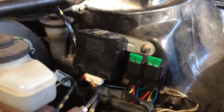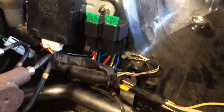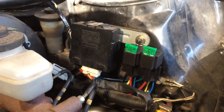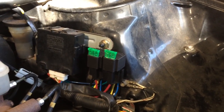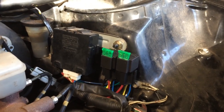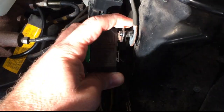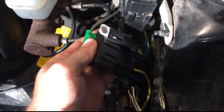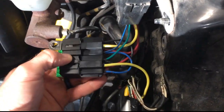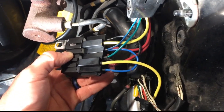Here are two of those fan relays that I have wired in. As you can see, the wiring is tidy — it runs right back into the loom. I still have to tape them up and put them back in their own loom, but it really doesn't look like anything's wadded up in here, and it is a pretty smooth transition. Flipping these over so you can see how I switched out those connectors with no soldering involved — you can see my commons are just looped over from one to the other, everything is heat-shrinked and runs right into the loom and to its devices.